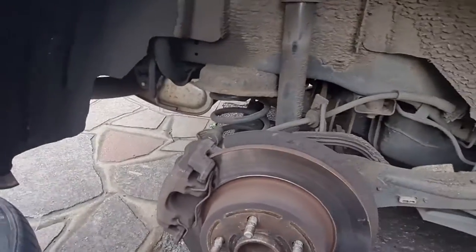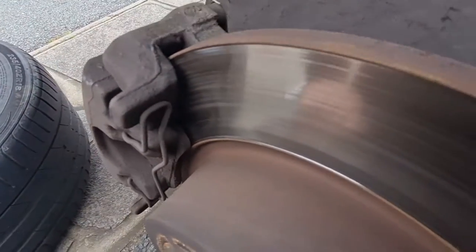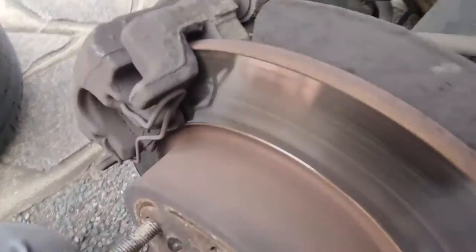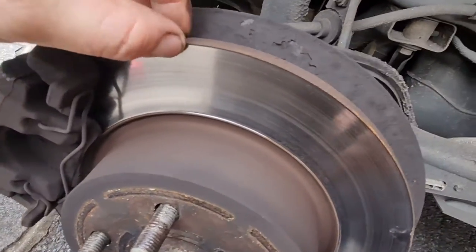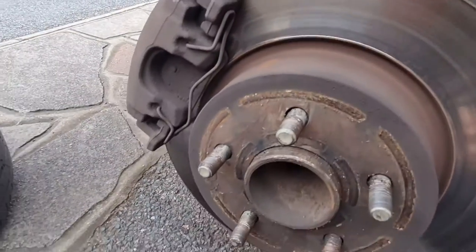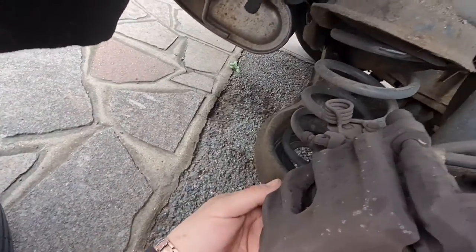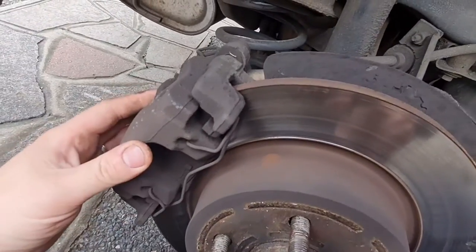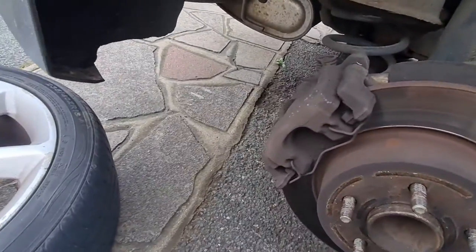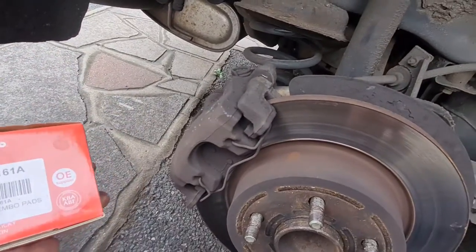With the wheel off we can see what we're doing. As you can see, there is not a lot of pad left. I can't see the back side yet because it's down in the groove. Discs look in okay condition — got a very slight lip on the edge, nothing really. We need to get this caliper off, which I've never actually taken off on this car before, and get the pads out, give it a good clean, and get these new pads fitted. We've got some Brembo ones to go on it — a decent make — so let's crack on.